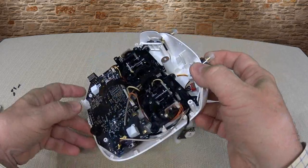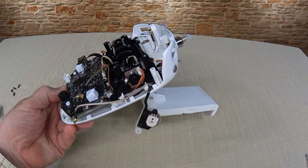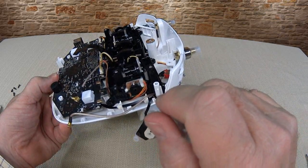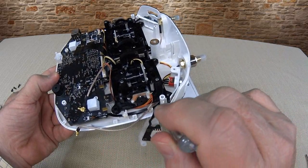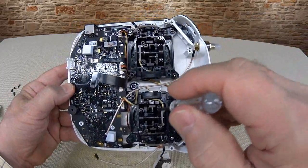And this one's a little trickier because it's got to go underneath this controller and pop out over here. Like I'd mentioned to you earlier, if you look closely, there's a lot of delicate cables in there. When this thing pokes its head out from inside that hole, it's metal. It's really easy to nick that flat ribbon cable there. So if you're at all unsure about this, I mentioned earlier you can take this unit out.